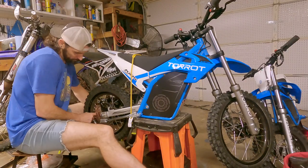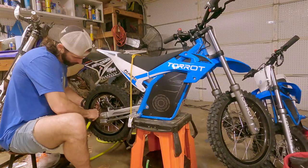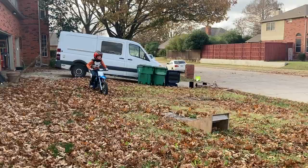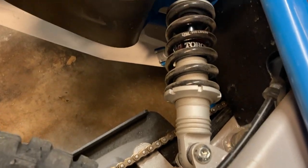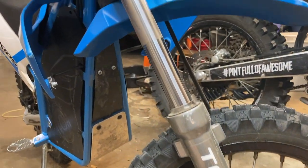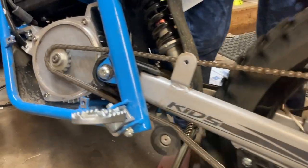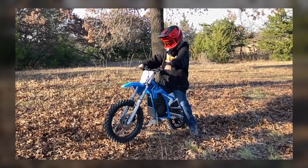As far as upgrades or adjustments, we've done very little. I'm not about to put bib mousses in these little tires, so I took the time to add slime to the tubes. I also moved the rear brake out and away from the grip for better placement of lever position for my young riders. I do wish the rear shock was a bit more robust. I know this price point is set for entry-level riders, but currently there is no tuning except for the ability to add some preload by tightening the spring. A few clickers on the forks would also be nice to see. We haven't had any issues with the chain, but it's a point that I'll be keeping an eye on. It's not on par with traditional minibike chains, but maybe this bike isn't meant to be put in those typical conditions. We'll certainly find out, as Liam is rough on everything.